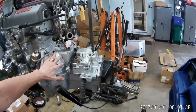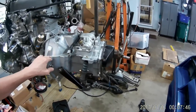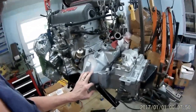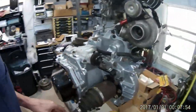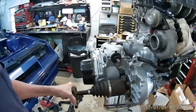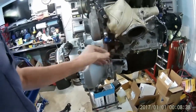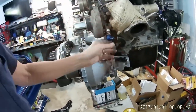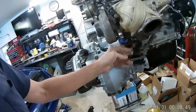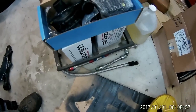The transmission is a 555 and I had Ed Pap go through it, replace the synchros, and totally redo it. We also put in a Quaife limited slip. The turbo is a stock turbo. For the 2.2 oil drain hose and all other hoses, I've changed to PTFE braided line, getting away from rubber braided line — I used to have those but I've now replaced them all.